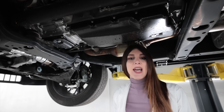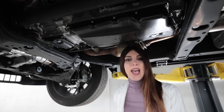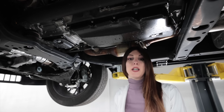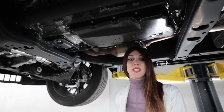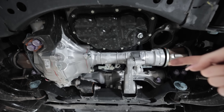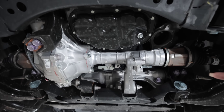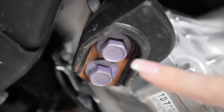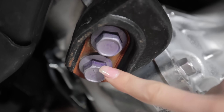This is the Direct Shift 10-speed automatic transmission, also shared with the Tundra, produced by Aisin — the AWR 10L65 — which has a maximum torque input of 650 Newton-meters. That's paired with the same front axle and diff assembly you get in the Tundra, which doesn't have any skid plates on it but does have a pretty sweet-looking dogbone mount and lots of lilac bolts.